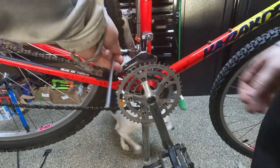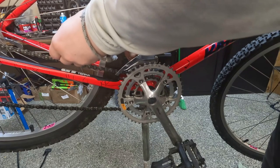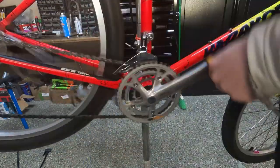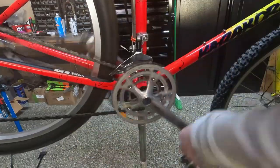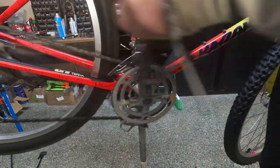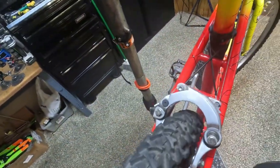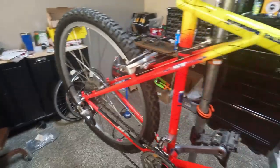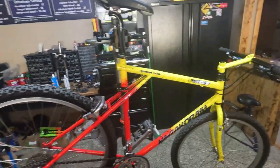We're going to add some cable tension to the front derailleur - just loosen this so we can add some cable tension. Now we'll see how this front shifts and we're good. Just a little bit of cable tension fixed everything. After fixing the front and rear derailleur, our brakes are looking good, equal on both sides. The front one's looking good too. The hubs are good - I checked those when I was truing the wheels. All that's left is to grease the seat post and the quill stem.